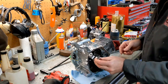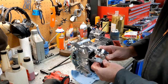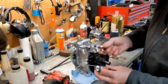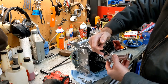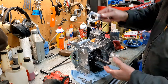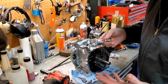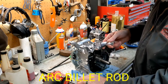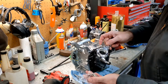And, yep, I had said that the stock, this is the stock rod versus the aftermarket rod. This is the dipper. Like I said, it's the splash oiler. This thing just dips into the oil and throws it everywhere, and that's how the motor gets oiled. Well, it's a plain dipper on this one, but on the aftermarket rod, it has this little scoop with a line or a hole going up into the big end bore, and that almost probably acts like an oil pump. This thing is dipping into the oil hard, and it's pushing it into this little scoop and pushing it right up into the big end to keep it oiled, which in this high performance application is great. So that's a really cool feature of this rod, aside from the rod itself being stronger than the stock one. And then of course also you have a plain bearing rather than Babbitt bearings, which will come with this. So this is also an improvement.